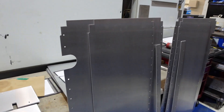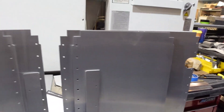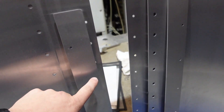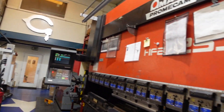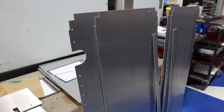Now that we've got those pieces cut out, we're going to bend the edges so they can fit into the bed of our C10. We didn't want to put flat pieces in there because they'd probably rattle around, especially with how thin we're making them. Bending the edges gives them rigidity. Here are our pieces — the finish is much nicer after the time saver. We have two lid pieces for the gas tank and battery, the two middle panels where the roll bar goes through, and then two rib pieces for support. We're going to bend everything on the press brake.